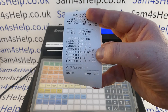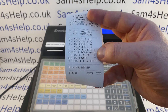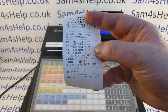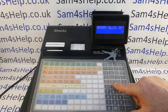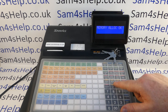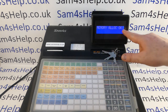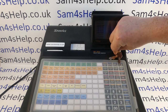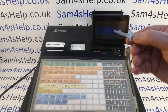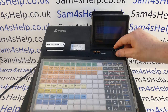The check line is the number of lines per transaction you can have — I'll go into more detail in the other video. Allocated level is the price level, set to two — so if you didn't want two price levels you could set that to one and get more memory for tracking lines. When it says 'Memory Alloc OK, clear service mode, closed,' I would turn the key all the way round to off and take it out, because you don't really want to be in service mode — in the old days that was a dealer-only position.